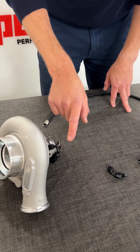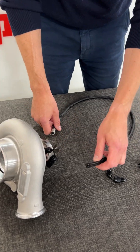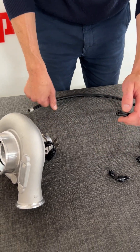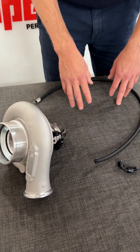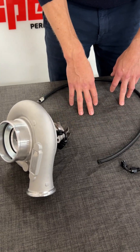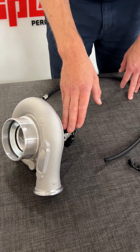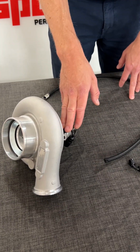Also note that if you use the oil feed you have to dimension the hose correctly. AN4 is most common, but you have AN4 PTFE and you have AN4 rubber hose, and these have different inside diameters, but both will work for the turbocharger application in most cases. So be sure to check what inside diameter you will need for your application and then use the correct oil feed hose.